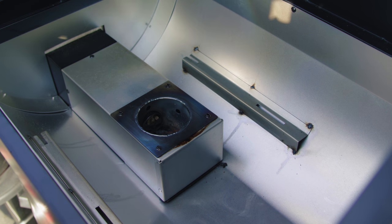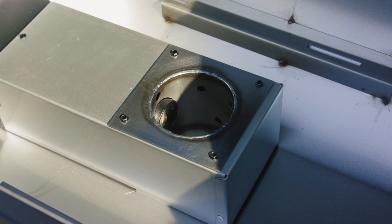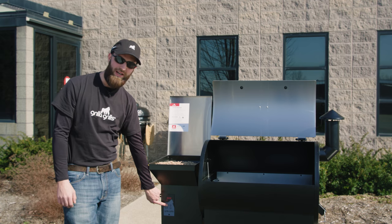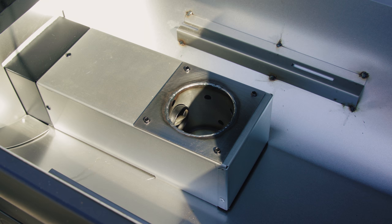All the components are out and the cooking grates are being washed with soap and water. Now go ahead and take note on the auger — you'll see that there's no fuel present inside of there. To start out, press and hold the on-off button to get it to turn on, and this will automatically start the priming process.